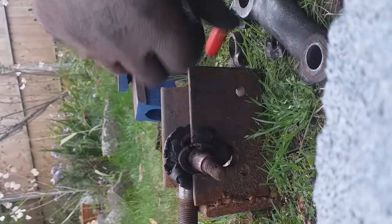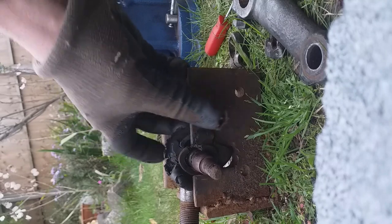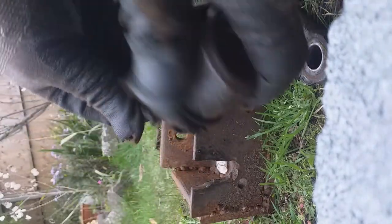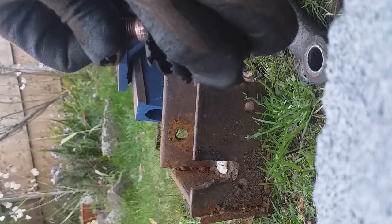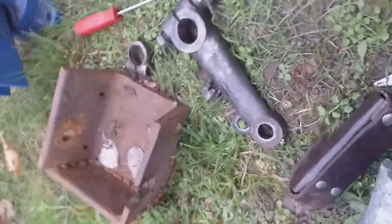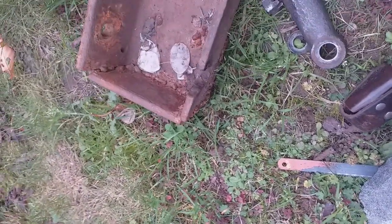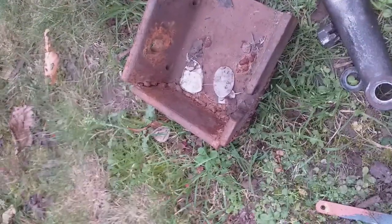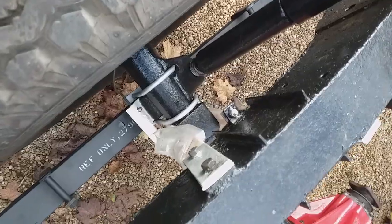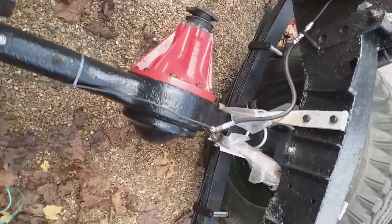The part of the spring that holds the spring clip with the rubber gaiter might have been digging in, but there's nothing rubbing in there. That's what I used - the thing with the slot. It needed a few hits rather than two. So from the rear left, to the T-piece, to the rear right flexible hose, the forward brake pipe through the bulkhead, to the five-way junction, the brake switch, the left hand, the right hand, and to the master cylinder and clutch master cylinder.